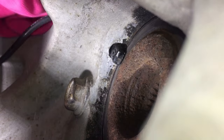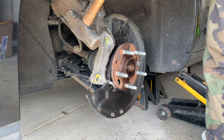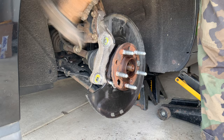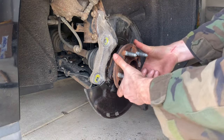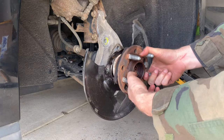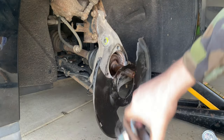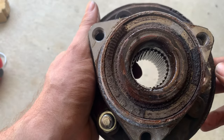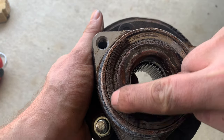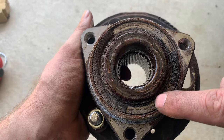This time the issue is a damaged encoder ring on the wheel bearing, which is likely the most common problem. Let's remove the wheel bearing. Note that wheel bearings don't typically come out this easy, including this one — this is the end of the process. I have endured many sledgehammer marathons with wheel bearings. However, for the last couple I've used an effective method to remove them easily, so this one was not a battle. I'll post up a bearing removal video in the future. Looking at the encoder, a large portion of it has broken off, which is why the sensor cannot detect the wheel speed. The remaining portion is in rough, deteriorated condition.